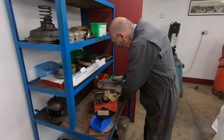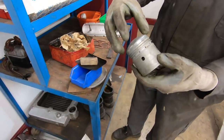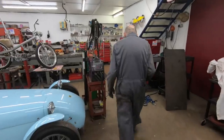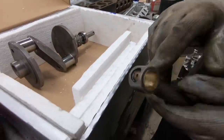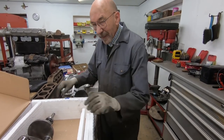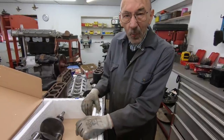We've got enough cam followers to do that. In amongst the stuff I looked for gaskets and found a brand new one, so that's a bit of luck. This is an original San Sebastian type piston with a funny crown - they used to put a pin through there, through the rod, to hold the gudgeon pin in. You can see the hole there. They put either a tapered pin or something - a bit dodgy really - holding the gudgeon pin in. But one of these cars did lap Brooklands at 140 miles an hour in the 1920s, so they must have been pretty good in their day.